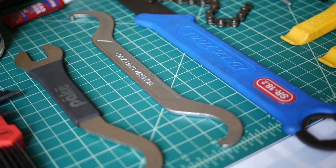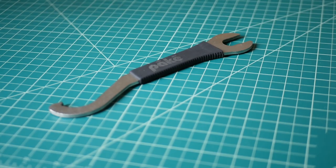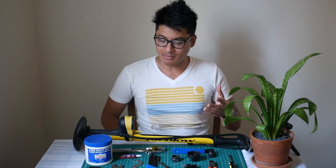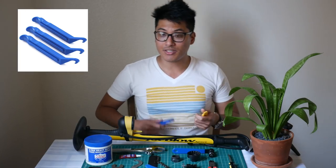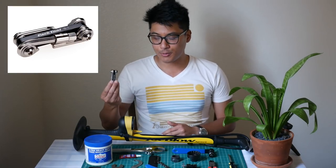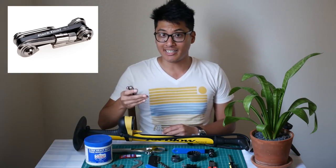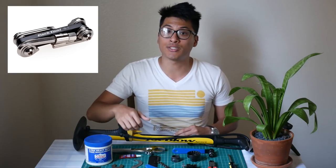It's a good idea to spend a little bit more on tools. If you skimp out, it can lead to a lot of headache down the line. Cheap tools aren't always machined very well, which makes it harder to do the job properly, and they make it a pain in the neck to work with. Good tools pretty much pay for themselves. As a general rule of thumb, Park Tool tends to make really good tools and is pretty much the industry standard, although there are some exceptions — tire levers is one of those, as theirs don't hold up very well. Pedro's tire levers are a lot better. As for multi-tools, in my opinion they do a lot of jobs worse. The more tools you add to one, the less useful it gets because the tools get in the way of the ones you're trying to use. I like to keep tools that do one job really well at home, so I won't need a multi-tool when I'm out on the road.